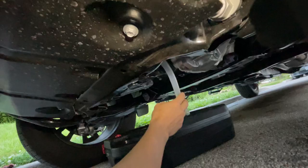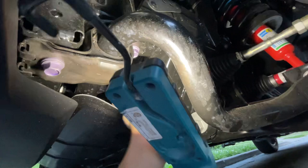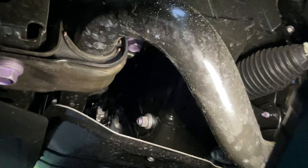Once you've done that, grab your ratchet, pop your filter remover on there. You'll reach up in there and crank it — there's no way to film it while doing that, but you'll take your ratchet, reach it in there and crank it. It's not on there especially tight; it doesn't need to be super tight. Then take that off.